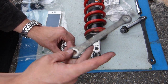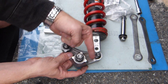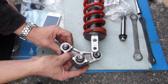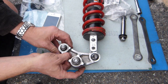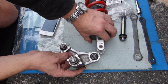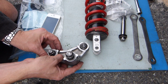This is how it works in operation: when the shock absorber extends down, such as going into a pothole where the wheel drops down, this extends and the linkage extends down. If I hit a speed bump, the spring shortens and it moves up. So in normal operation it just moves a little bit up and down — it does not ever make a 360 for any reason.